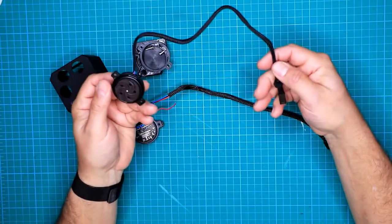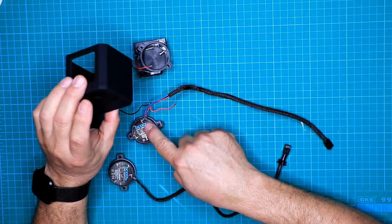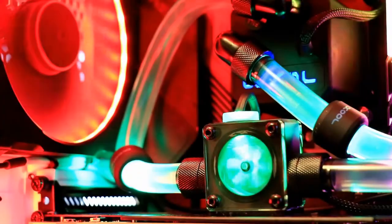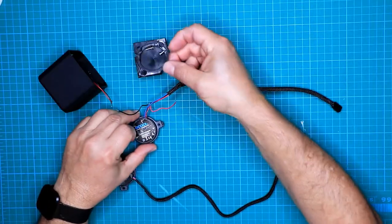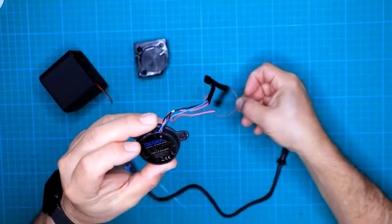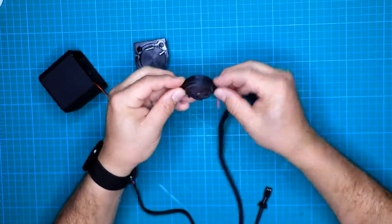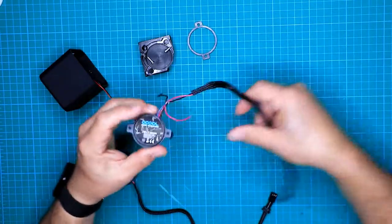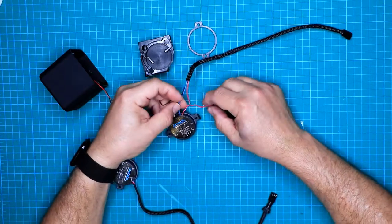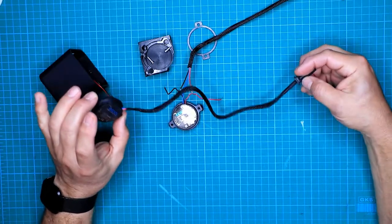They sent me this pump motor which will work fine, but this pump has an LED light on it, and if you want to keep it you've got to rewire it like the original one. I've already done a little disassembly — we have this ring here that went on the top, originally held down inside this structure with these screws, and we need this piece to replace it with. The challenge is they spliced the ground and power wire in-line, so we need to modify it.